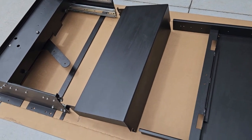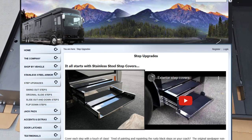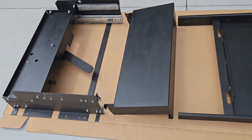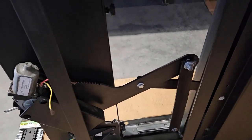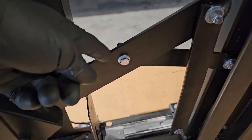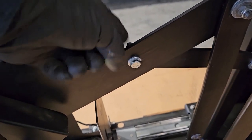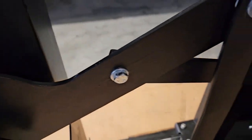I'm going to put stainless steel covers on this, which is a lot better because the coach colors scratch anyway. The stainless steel covers came from Summit. A couple of things to note when taking these steps apart and putting them back together: make a note of which way the bolts face. If you've got a long shank heading out the bottom and the mechanism starts to collapse up, there's a possibility of a jam.